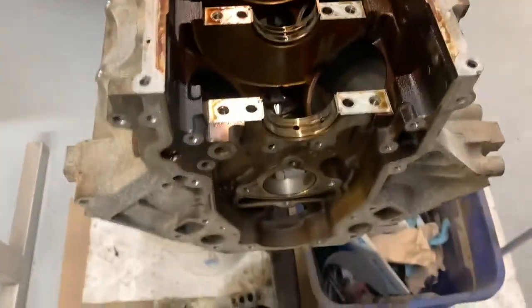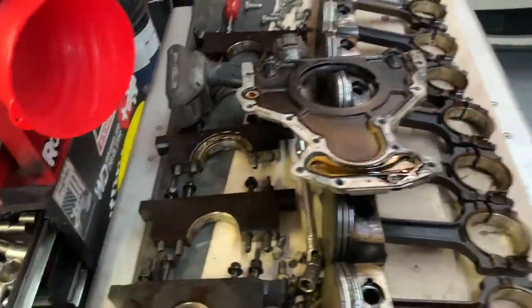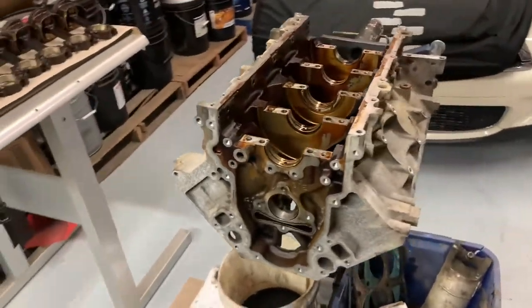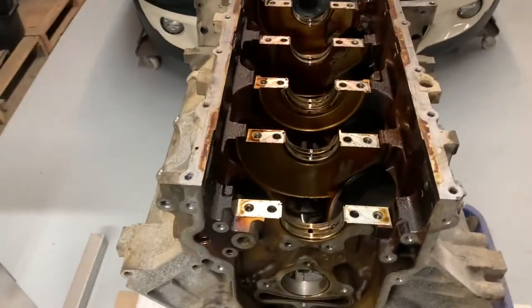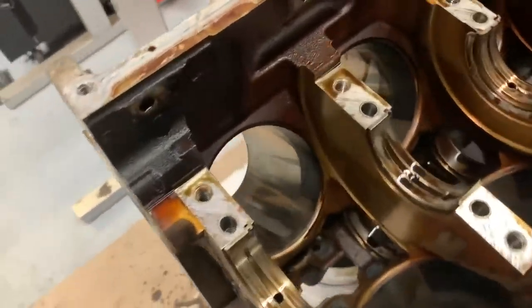The block is completely empty. I'm going to take these bearings and lay them with each cap — all the caps are in line the way they're going to go. Rear cover. All the pistons are laid out. I think it's just as well for me to power wash this block. Usually that's what I always do — soak it down really good with some Clean Flow engine degreaser, that's wicked stuff, and then power wash it a couple of times. This will be whistle clean inside. It's actually not bad at all, just some darkness from oil being slung around.